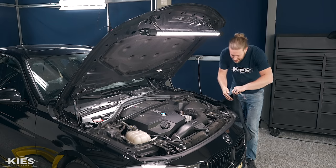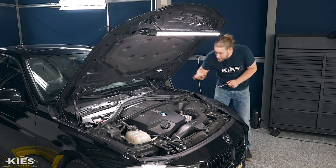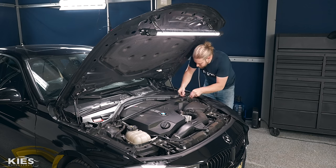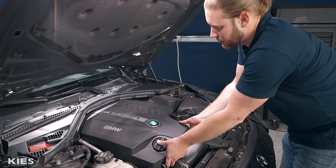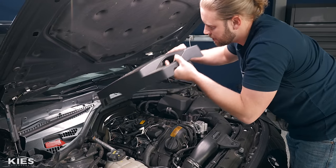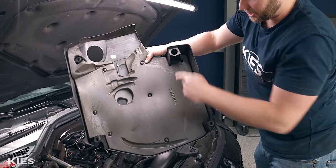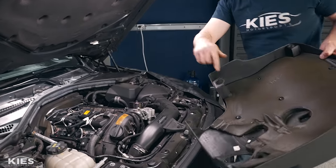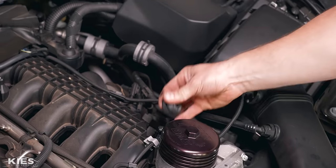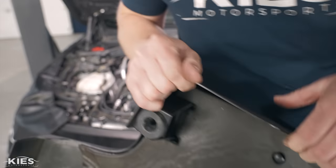To show you where it's located I need to remove the engine cover, which is covered by an aftermarket strut brace. If you have a strut brace, remove that first and then remove the engine cover. You can just gently lift up on your engine cover — it's held in with a couple of little rubber grommets. If you flip it over you can see there's two over here, one up here, and one down here. This one often gets stuck, so just pull it off and press it back in before reinstalling.